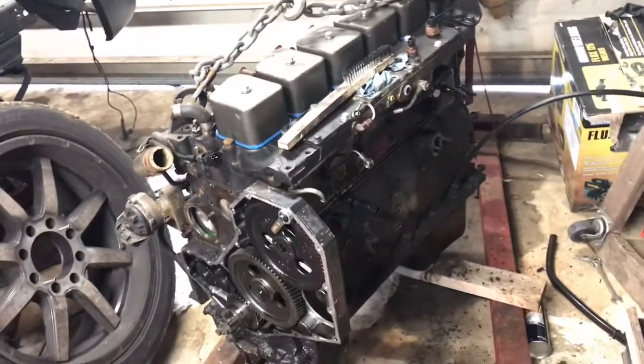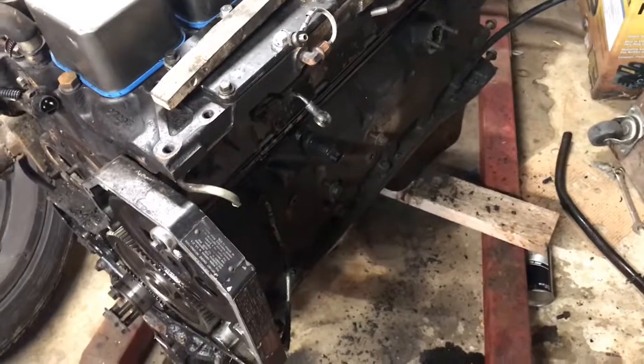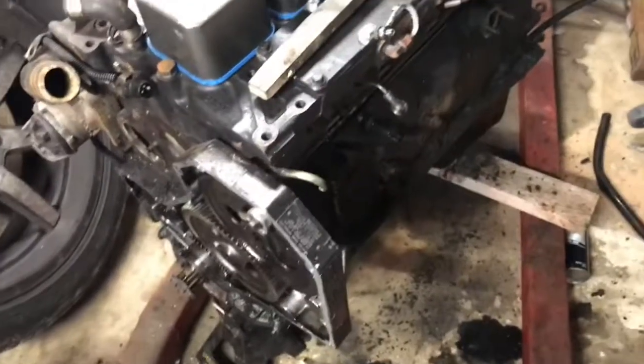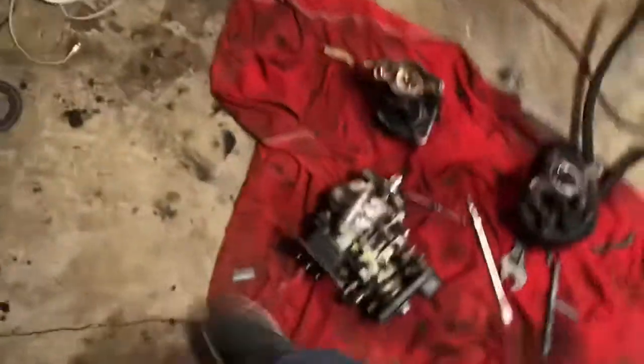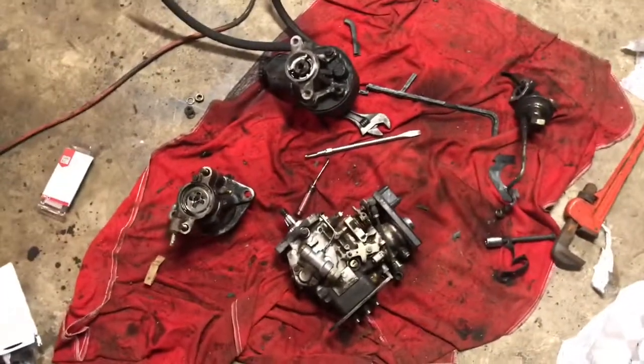It's like 3 o'clock on Saturday and I have to drive out west about an hour away to get a fuel line — apparently they don't sell them anymore. It's just the main fuel supply line for the injection pump, goes from right here to here to that banjo nut. I started to loosen it on the pump and saw it starting to twist, and it was already kinked so there was no saving it. I just twisted the rest of the way off thinking I could get the line fairly easily because it looks simple, but turns out they don't even sell it anymore.